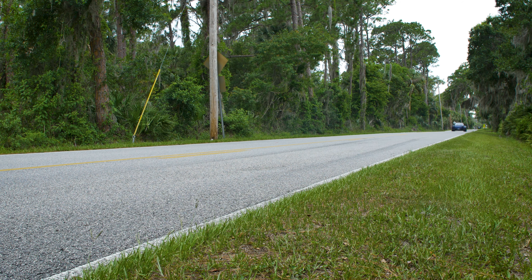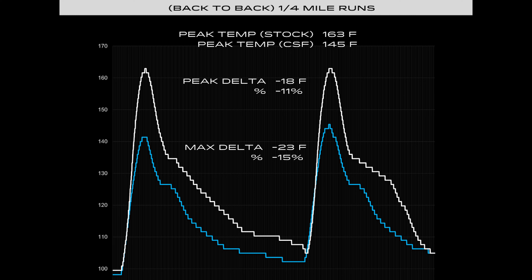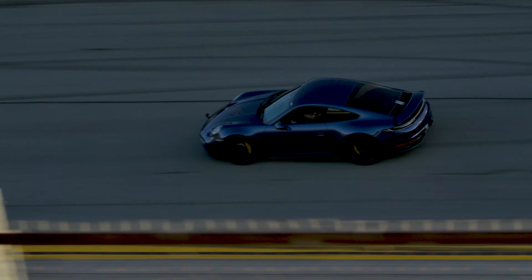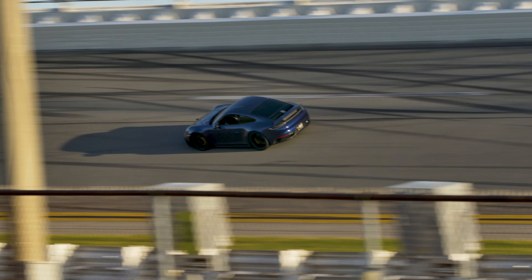This is actually where the difference shows up the greatest. You can see on the graph the stock reached 163 degrees Fahrenheit, where the CSF only reached 145 degrees Fahrenheit — an 18 degree Fahrenheit difference, or about 11%. The max gains are actually about 23 degrees Fahrenheit at the biggest point of delta, which represents about a 15% reduction in IATs. That's going to be huge, particularly if you're tracking the car, where you're consecutively getting on the throttle under load with a lot of boost.